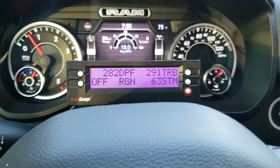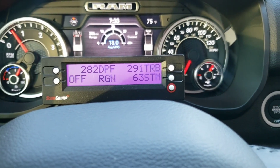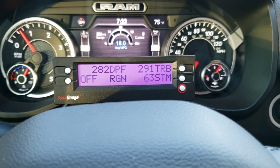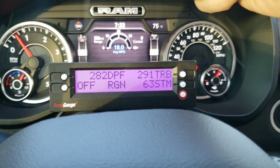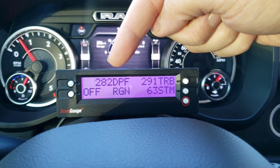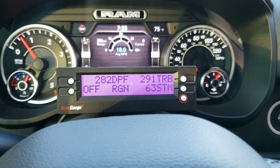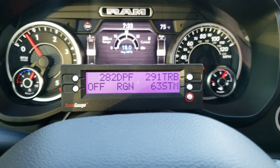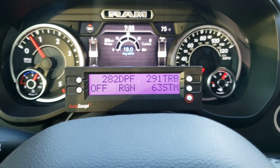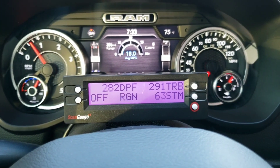This is really helpful, and I've got a lot of other gauges in here too. You can look at turbo boost — how much boost the turbo is providing instantaneously — and there's just all kinds of things you can do with this. The diesel particulate filter temperature is obviously directly related to whether or not the truck needs to do a regen, because if the temperature is high enough during your normal driving, then it won't have to do a regen, which is awesome.